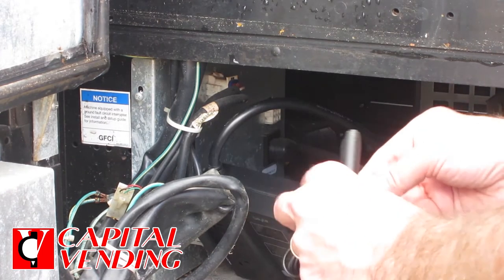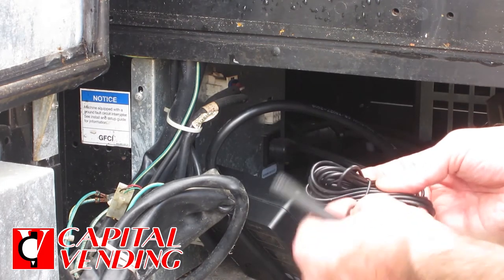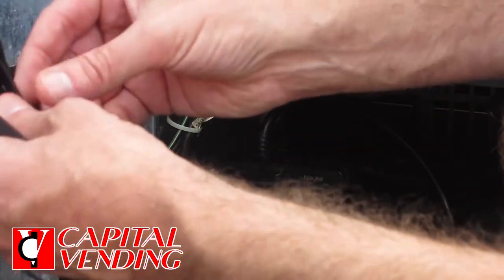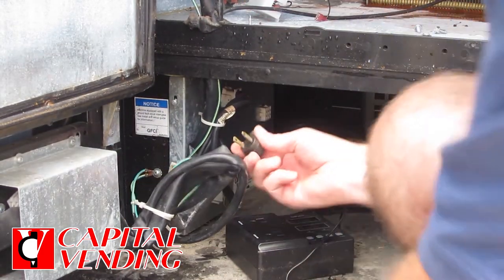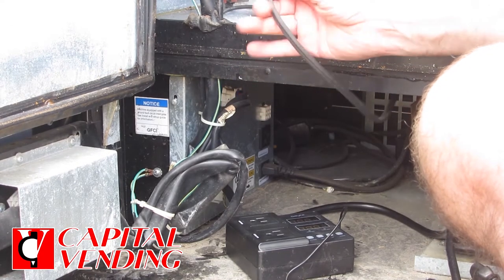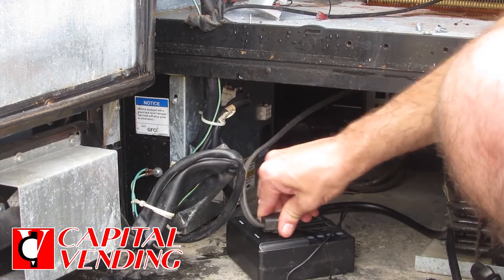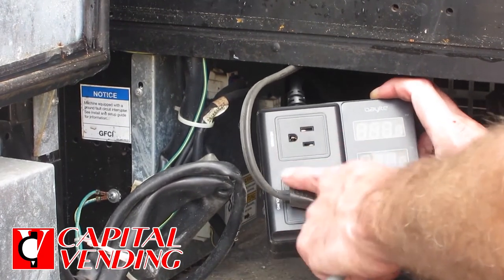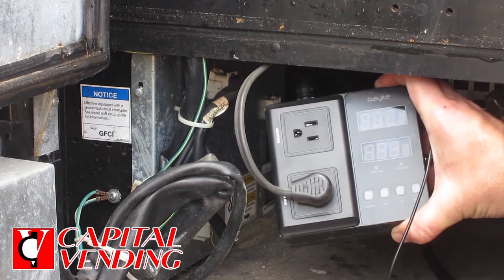You will no longer need the thermostat if you elect to plug in your refrigeration system. The nice thing about mounting it here is it's easy to run your new temperature probe. If you are going to use this to control your cooling, very typically on the refrigeration system there'd be a two-prong plug like this. The larger plug connects here. Typically these refrigeration systems are not grounded.